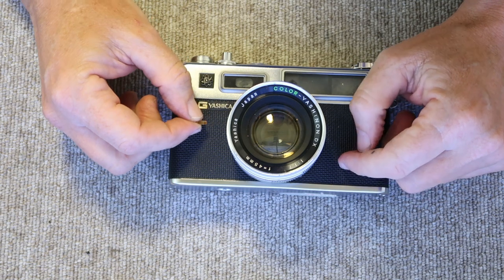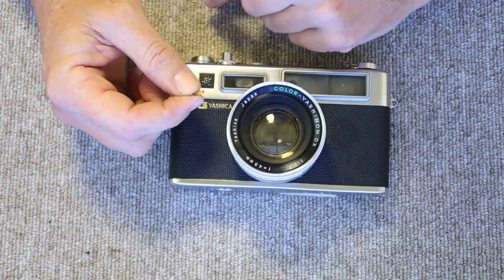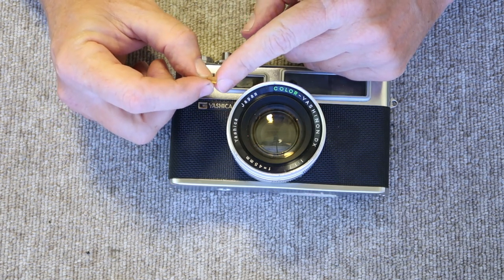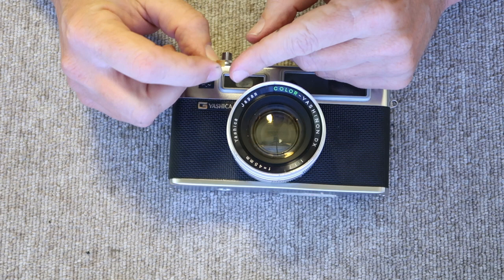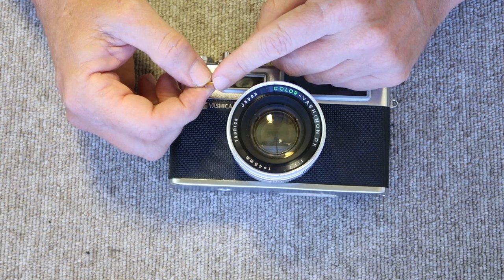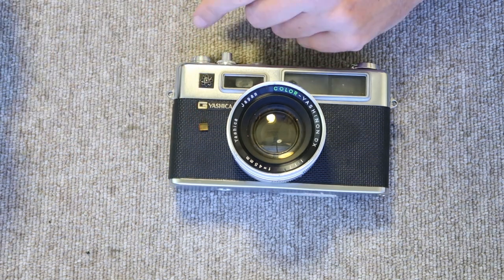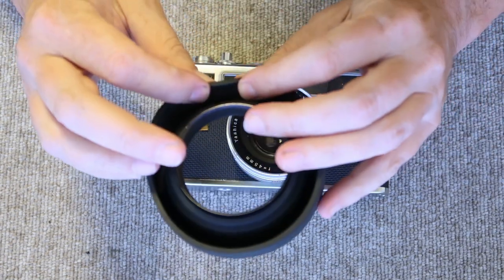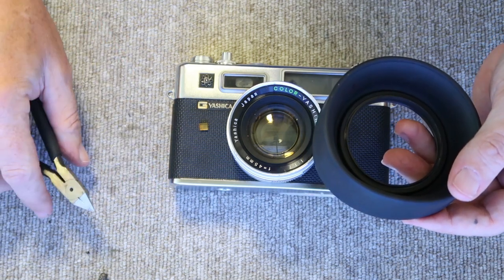So what we're going to do is open up the camera, clean out the spot where the POD is, and replace it with this one here. I got a whole bag full of these from someone who was selling a bunch of old Yashica parts. If you don't have one of these, it's not a problem. You don't have to have it made of any particular material. It's quite a simple thing. When I didn't have some of the old Yashica PODs on hand, I simply used rubber from these old Mamiya lens hoods, which was about the same thickness, and I would just cut them using a pair of wire cutters to the right dimensions and slip them in.